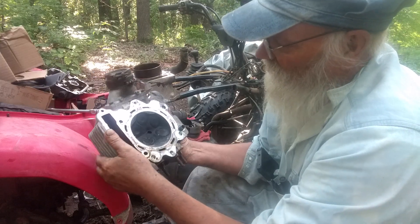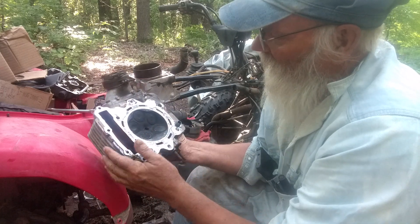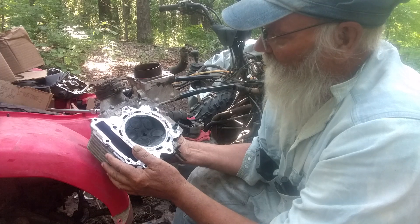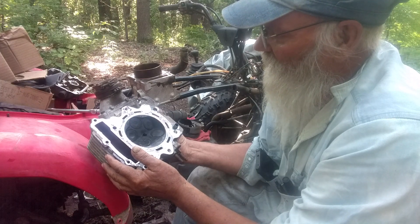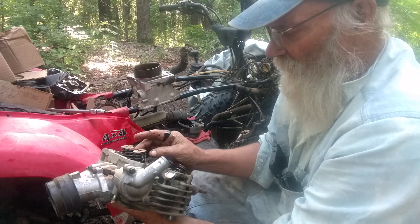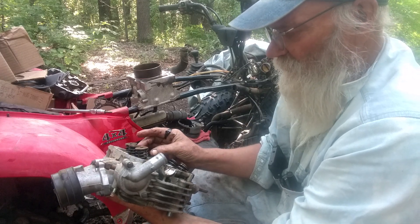As you can see, there's a little carbon on there. I have not decided if I'm going to grind the valves on this head yet. I'll probably fill it up with diesel fuel and just see if it leaks any out, but I don't know that it would be necessary to re-grind them.